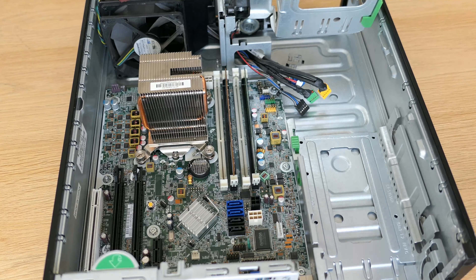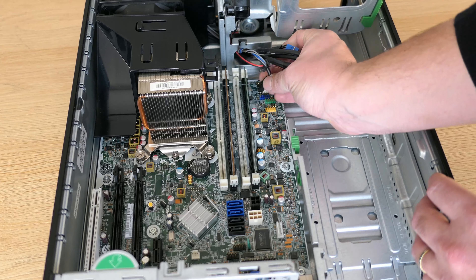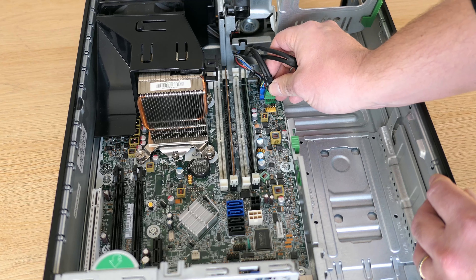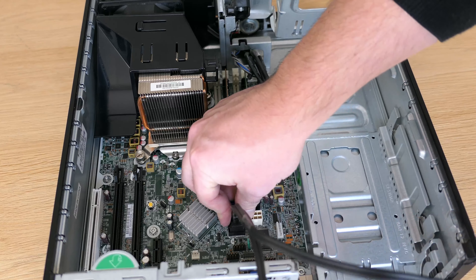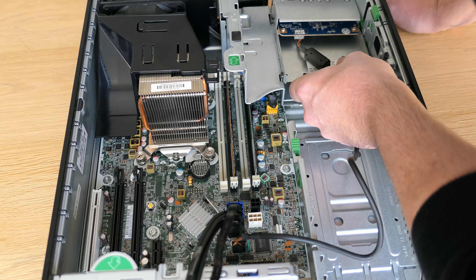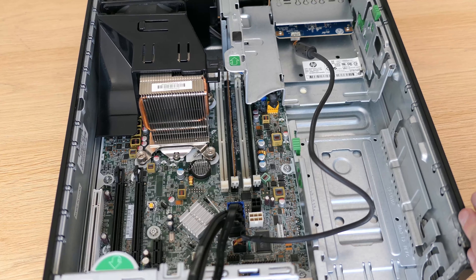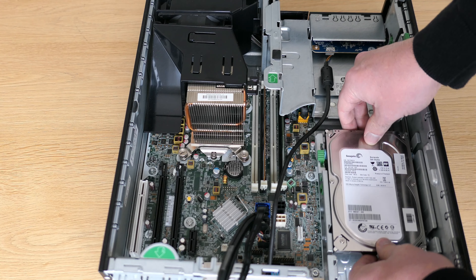Since nothing else is holding the motherboard, let's remove the screws that hold it in the case. Once removed we can get the mainboard out. The memory configuration is a bit strange — with three DIMMs the machine doesn't run at its best as we won't be using dual channel. The modules have an HP sticker but I can't really imagine HP supplied this configuration: one 2GB module and two times 1GB, all from different vendors. The CPU can easily be removed from the socket. The motherboard is completely free now so let's take a good look at it.